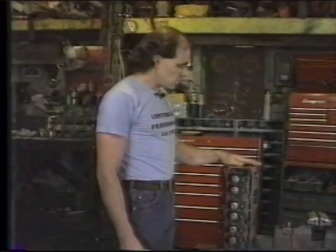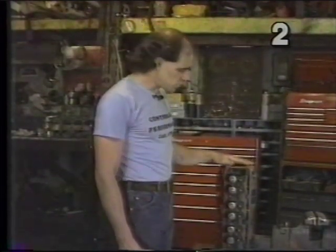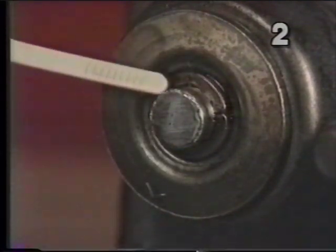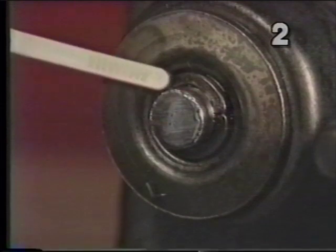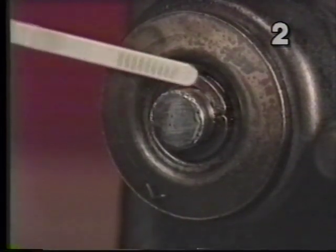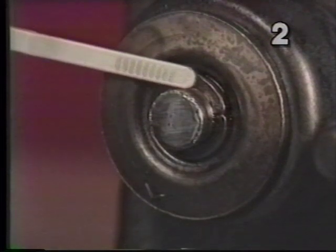If you recall before, when we were disassembling the engine, we started talking about areas of a cylinder head and valve train area to look at and inspect. If we look at this one, we can see around the edges the metal is actually chipped and broken. If this condition were much worse, the valve would have to be replaced. Fortunately, this one can just be reground with the proper equipment, and if the rest of the valve is in adequate condition, it can be reused.